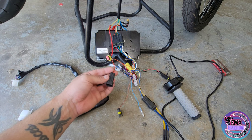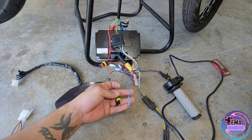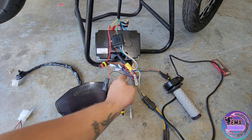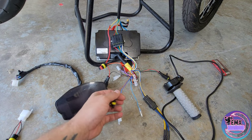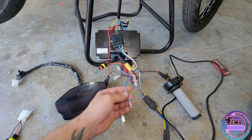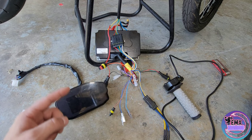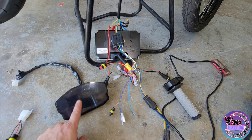We're going to be using this power to power up the DKD instead, and then from there all we need to do is plug in our one-line signal. Now for the 72-450 and 72-680, the one-line communication is through the brown boost wire, paired with a blue wire with a red stripe on a two-pin connector. I just chopped it off and put a single pin connector onto it. If that one doesn't work for you, use light blue — this was originally the one-line communication wire and may still be for your 72-300 or other models.